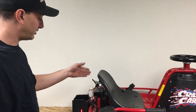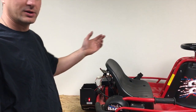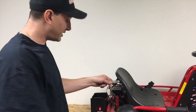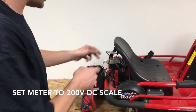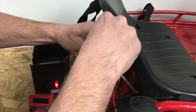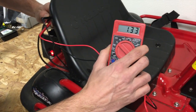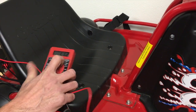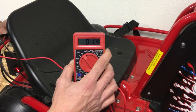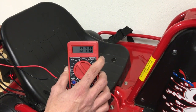So we've ruled out the batteries, the power switch, and the throttle. The cart's still not running, so let's check the motor leads — we're going to put the meter on the motor wires and see if we get power going out to the motor. Press the throttle and look at that — switching to the 200 volt scale, we're getting power to the motor. Holding it down, pressing all the way, you can see it going way up. So we've got power to the motor but it's still not going.